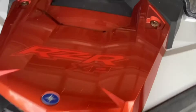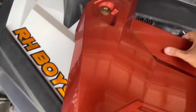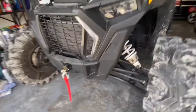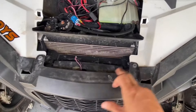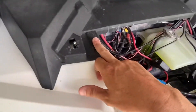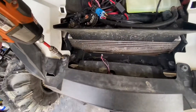The first thing we've got to do is pop this hood off. There are little push pin releases to get the hood off — it just pops off like this. Put that off to the side. Now we're going to have to start pulling a lot of the front fascia off, so we'll pull off the front bumper and also this plastic piece as well. These are T40 Torx bolts to get those off.